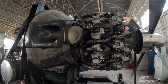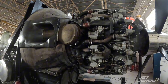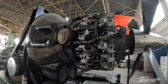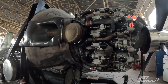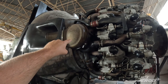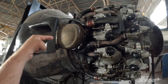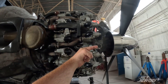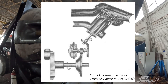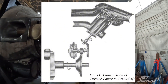The idea behind this — you've seen superchargers, you've seen turbochargers, but this is a little bit different. They wanted to add more power without increasing specific fuel consumption. They also didn't want to increase complexity for the pilots or for maintenance. So what they did was take a turbine — like a turbocharger — and put it inside here. They let the exhaust gas run over it, which spins the turbine up, and the exhaust gas exits. Meanwhile, this turbine is connected via a drive shaft down to the crankshaft, which actually helps spin the crankshaft and turn the propeller — recovering power you would otherwise lose out the exhaust.